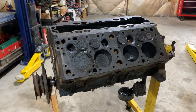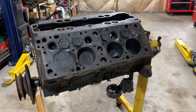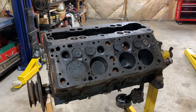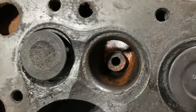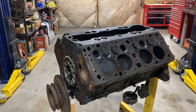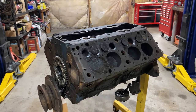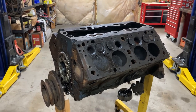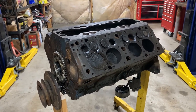In this one's case, it's a little unit that has its own frame and radiator, and it's got a big pulley system off the back with its own clutch — just like a bell housing with a pulley behind it. It had been sitting outside, so of course it seized up. Flatheads are famous for sticky valves when they get any moisture in there. I filmed a couple of videos, tore it down, got it on the stand, and then the videos quit — that was a few years ago. These things are pretty spendy to do anything with, so it basically got shoved into a corner and covered up.